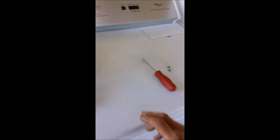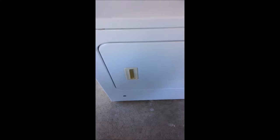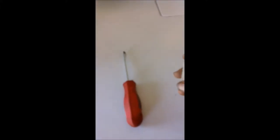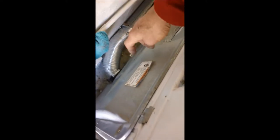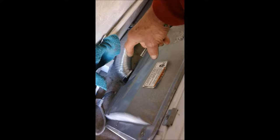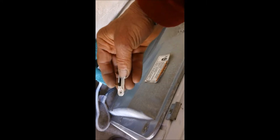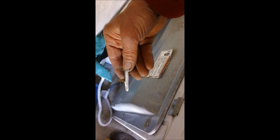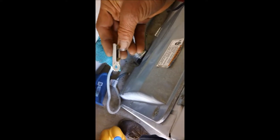I'm going to show you a little bit of how this thing works. First of all, I wanted to let you know about the thermal cutoff fuse. This fuse is located in the back behind this panel. This one we didn't have to replace. Usually the thermal cutoff fuse will go bad when the vent is kinked or there's poor airflow in or exiting the room. This thermal fuse is a one-time, non-resettable fuse — it has to be replaced when it's burnt out. Your dryer may not heat or may not come on if this fuse is bad.